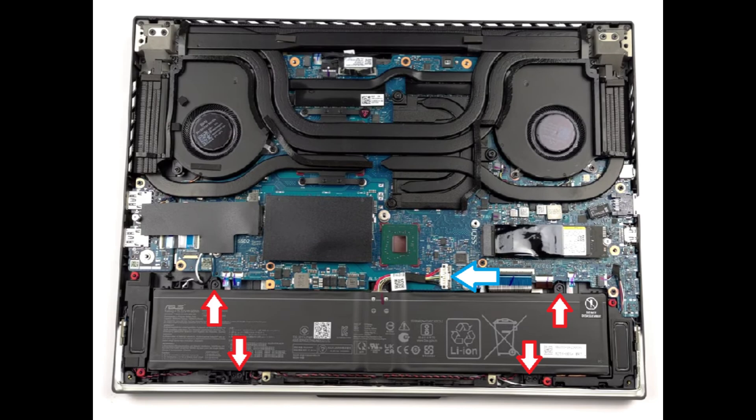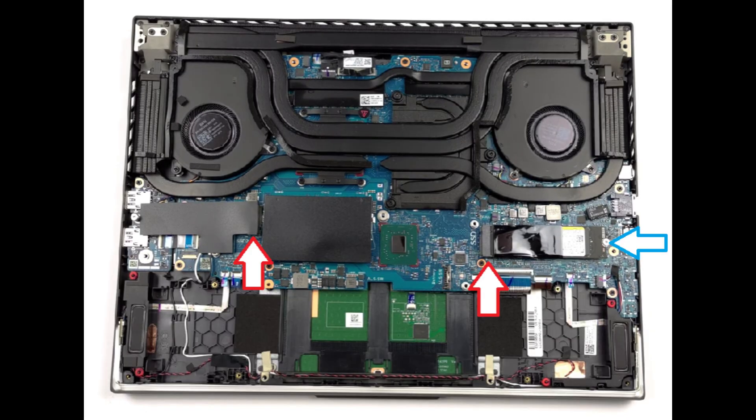You have to slide that bar to the right and that releases the battery plug. After that, you can pop that battery plug directly up and off of the motherboard to unplug it. As far as storage, noted by the red arrows, this computer has two M.2 NVMe PCIe ports. They both take 2280 sized Gen 4 solid state drives. I will have all that information below in the description, and I will also include several replacement and upgrade options in that list.